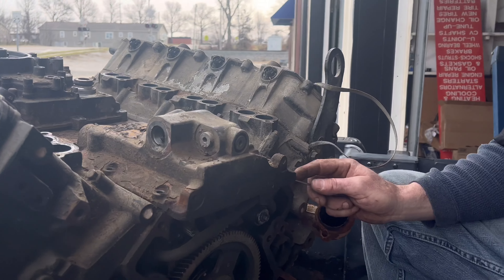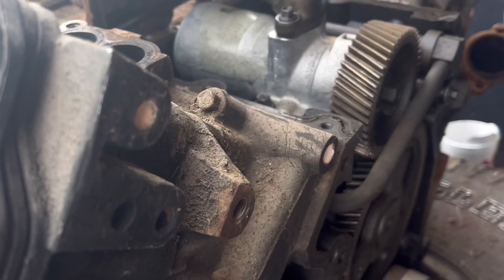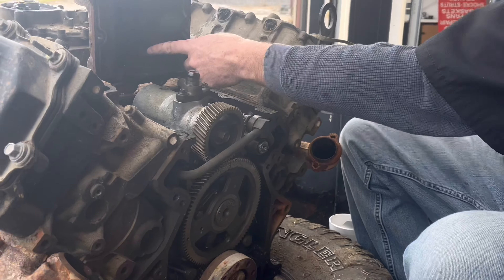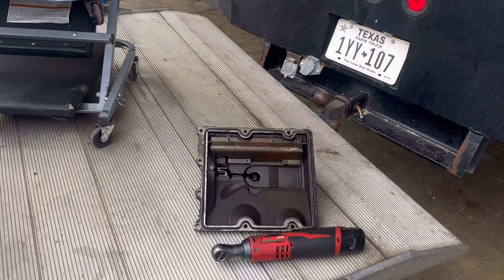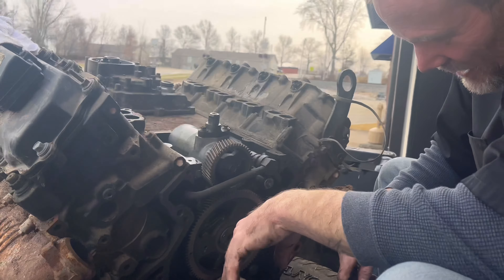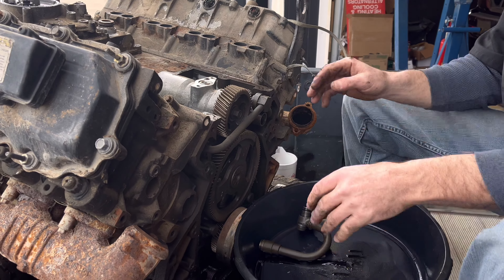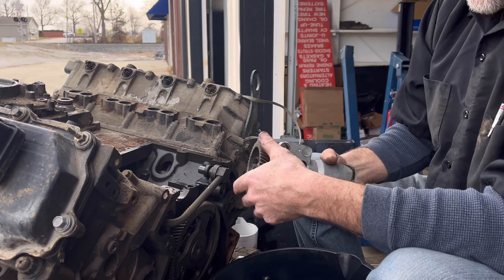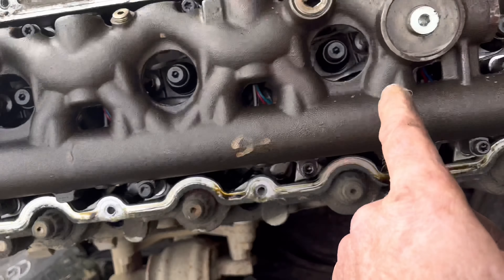Pump cover off. We cleaned it up. Let's see how hard it's going to be to get off - not hard at all. The BB is still in. Okay, it is an updated pump cover right there - has the little notch in it so it doesn't rub the j-tube. It's a good thing to have handy. Whatever oil is in there is going to go right here. There's nothing we can do about it. Grab our little baby drain pan, maybe I can catch something. If it's dry, it's dry.